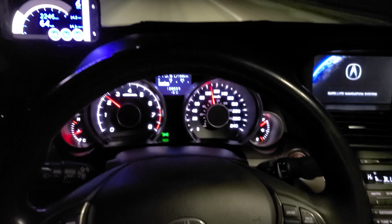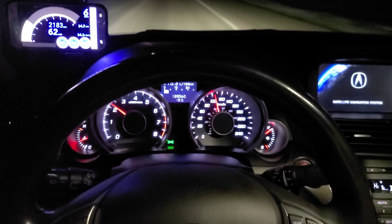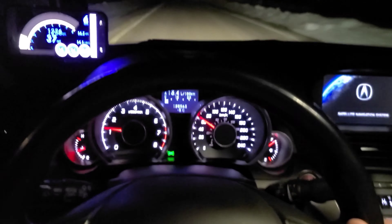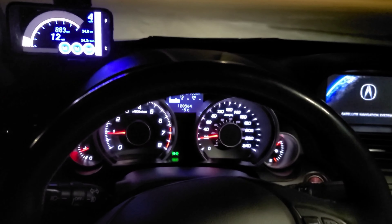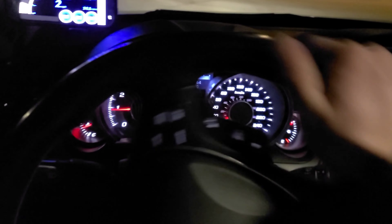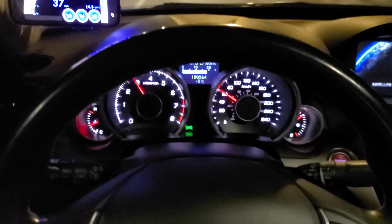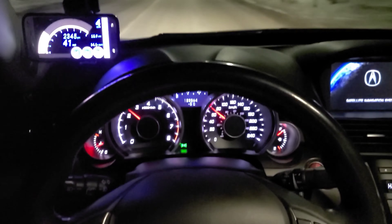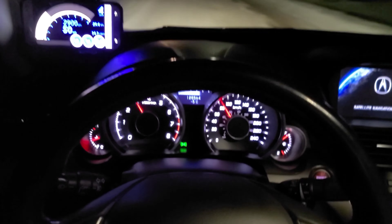The pre-cat deletes were mind-blowing in first gear with how much more it pulled. Believe it or not, lightweight wheels made a really noticeable difference in acceleration. Right now I have my heavier OEM rims, so I'm probably losing about 10 wheel horsepower there. Lightweight wheels are a huge difference, especially with all-wheel drive — less rotational mass on all four wheels spinning. 19s and 20s look great but you're killing the performance of your already not-so-fast TL. Get lightweight wheels, get some coilovers to fix the wheel gap, and you're good to go. Anyway guys, that's it — hit that like button, comment, share, subscribe, and I'll see you next time!